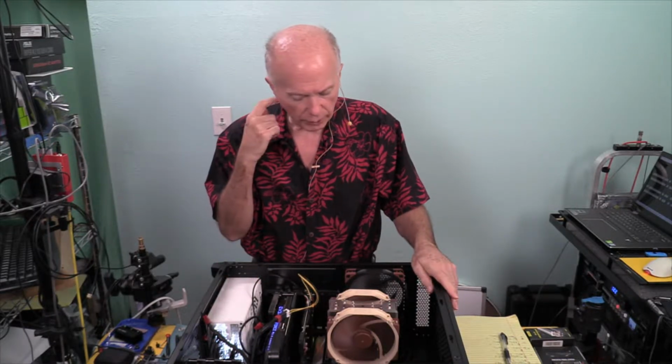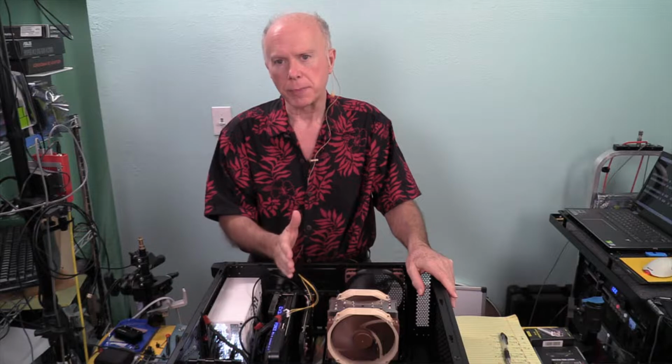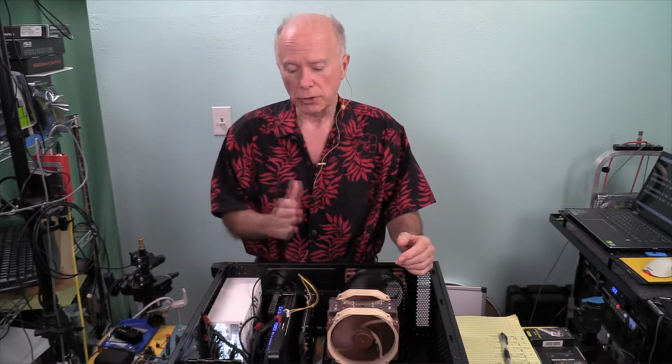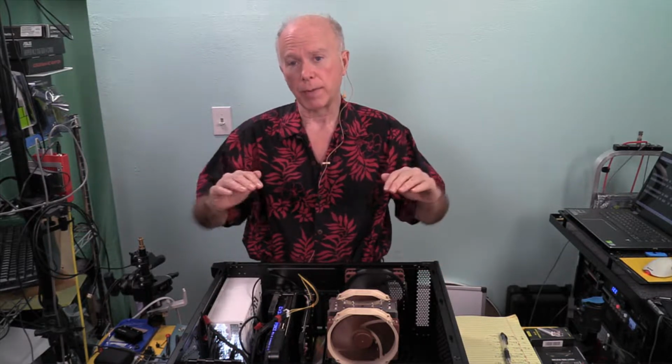So far, I think what we know from what we've established, whatever drives you buy for something like this, I wouldn't necessarily buy according to the spec, which is the PLX PCI Express 3.0, but I would buy the drives which show you the best value for the money, because they're backwards compatible, you can always migrate those drives to another machine. You haven't done anything to hurt performance. You just got a governor on them that keeps them down.